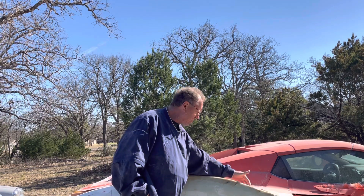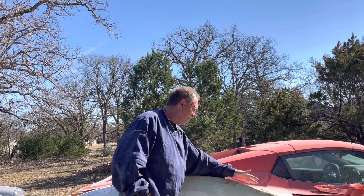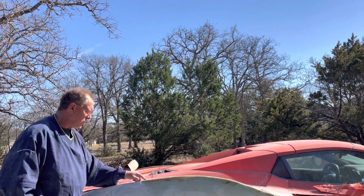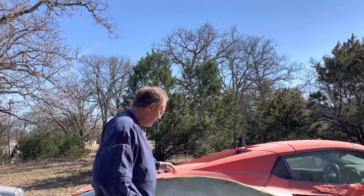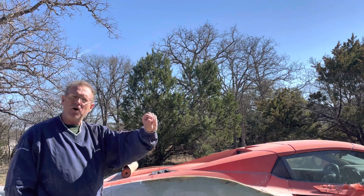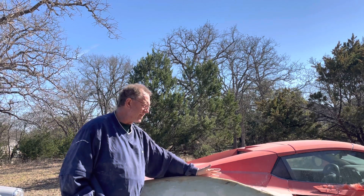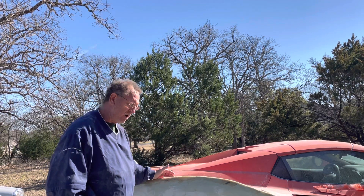I cut this panel out — it was temporarily attached — so I cut a notch in here. When I cut this curve the way I wanted, I saw that if I moved this back about two inches it matches the curve where I wanted. So that's what I did: cut it, moved it back two inches, and put some screws in to hold it in place. But before I put the screws in, I went into the foam and cut the foam down the thickness of this piece. That allowed me to put this piece on top, screw it in, and it was in exactly the right place.